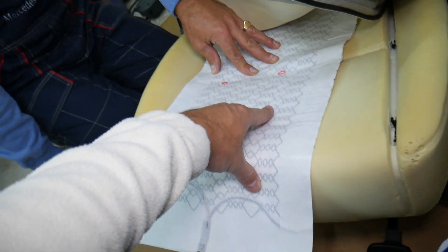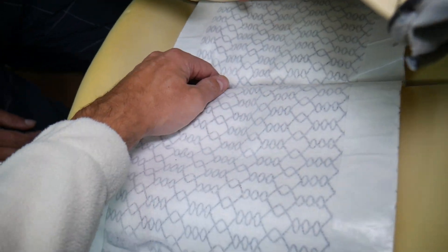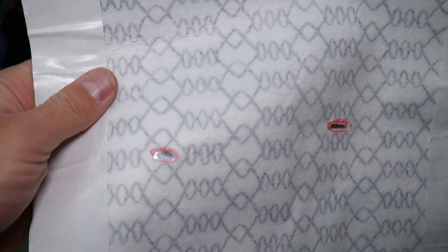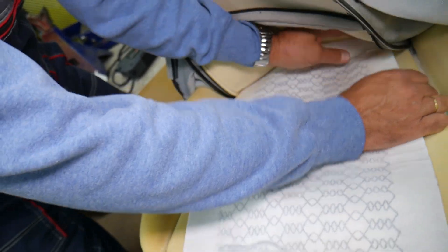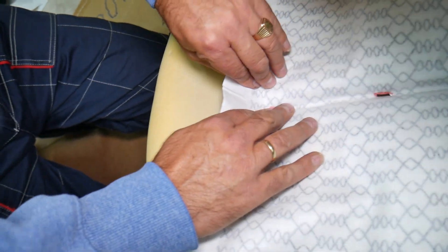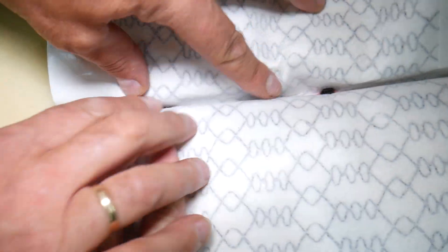This is the heating element for the Volkswagen Tiguan. We need to fold it and cut around the clips without damaging the heater wire so we can install the holder and the seat looks nice and tight. We marked everything and will cut the holes — we also put reflective tape around them to reinforce the construction since it sits in the crease. We're now aligning everything and pushing it through the clips — it needs to be folded so the clips come through correctly.